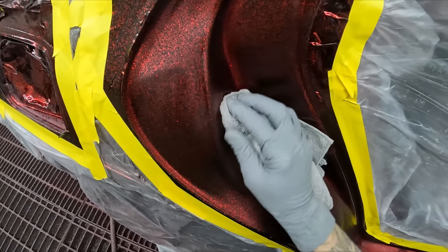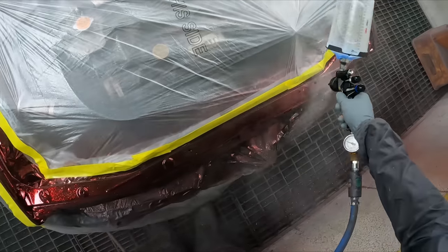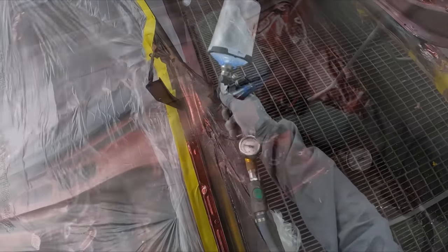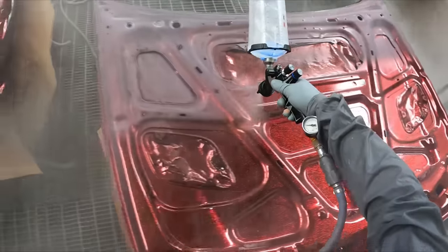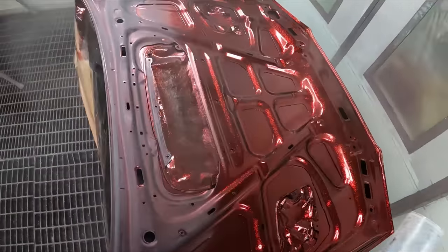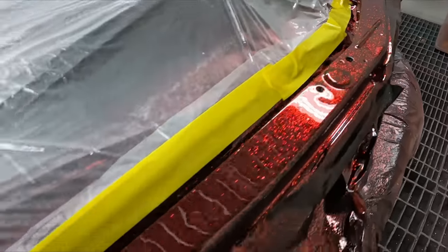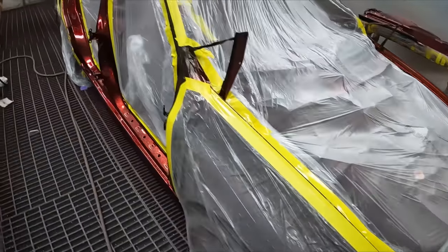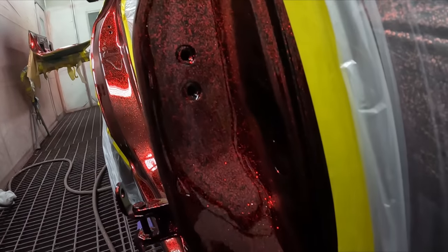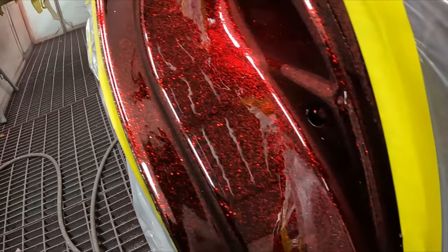I gave it a good sand — started with 500 grit, then 800 grit, then 1000 grit grippy pads. Between every single coat I've been baking it — a 10-minute bake between every coat of clear. I used standard medium reducer because I find it gets a touch more flow; you don't get much flow with most PPG clears. The final clear you saw me spray is my favorite PPG clear, the D105 — higher gloss, goes on glassier, dries fast. I prefer it over the D136, though the D136 is nice and thick, which is why I used it to fill the flakes.